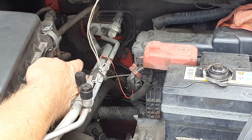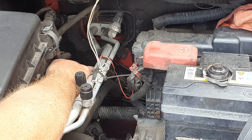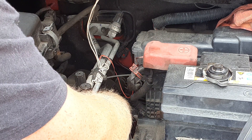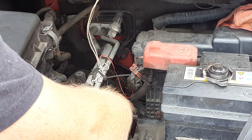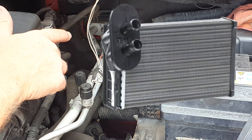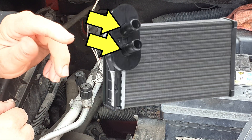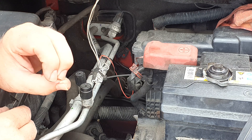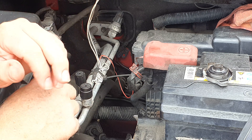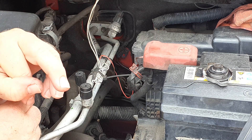It's also wise to disconnect the hoses from the in and out on your heater matrix and give your heater matrix a flush. I'm going to disconnect the hoses at the block because on this car they're much easier to get to that way. The reason is that most cars have the in and out connections of the heater matrix on the top of the heater matrix. Unless you absolutely know the connections are on the bottom, you probably haven't drained it fully, which is also another reason why sediment and corrosion product can settle in there — and we want to make sure we've got that out.